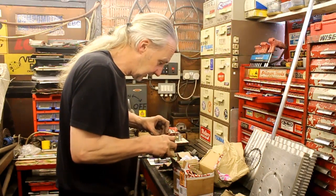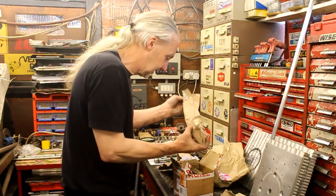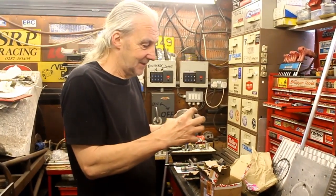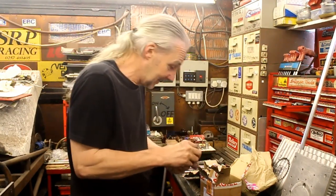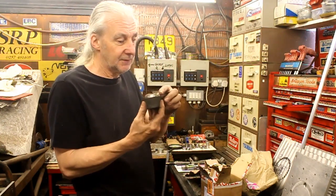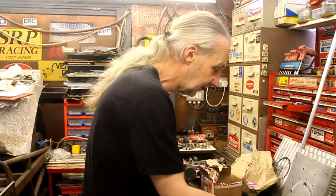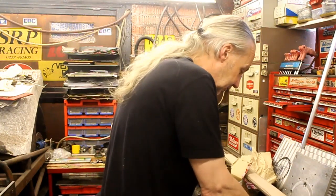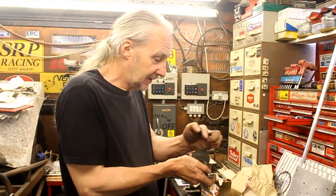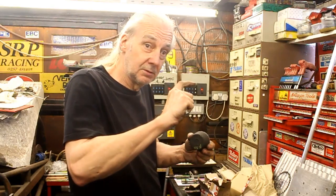No, you're going to end up using most of that. I'll just machine it. Hopefully it's going to work. What we need to do is get it centered, flat as much as we can. Obviously it's an odd shape, so I guess nobody wanted it. We've got a datum point there, so I can put that in the chuck. I can put a hole through it, 12 mil, and then I can use our 12 mil centered bar. Then we can bolt that to it with a piece, and then you can machine that down as appropriate. And then you've got a good area.